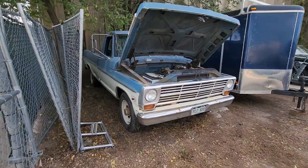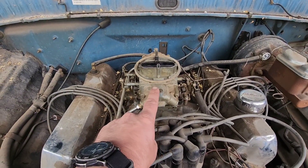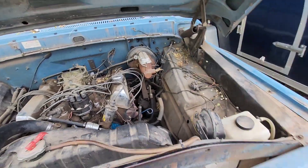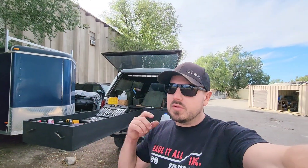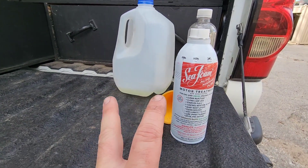It's been sitting here for a minute. I did get the old battery charged up and I'm gonna go ahead and prime the carburetor. I know this one rolls over. I'll probably check the oil just for good measure, but otherwise just get some gas in the carb. What I like to do is use some Sea Foam - when this carb's been sitting at least six months and it does have ethanol fuel in it, you really only get about three months before that fuel starts to wreak havoc on carburetors. Some might call it the Italian tune-up.